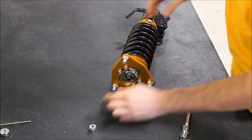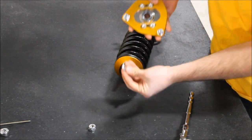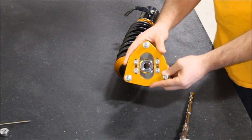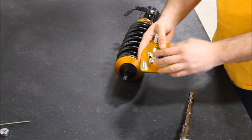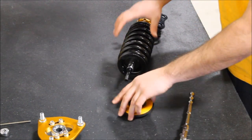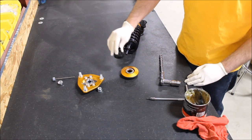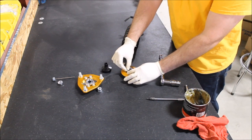Now that our 19 millimeter nut is off, we will find a small washer right here. Put that aside — don't lose that. Here's your whole camber plate assembly. They will look different from model to model, whether it is a pillow ball upper mount without the adjustable camber or just a plain top plate — either way it's going to look the same. Now your thrust bearing will simply slide out. Then simply lift the top black cup off of the spring perch with the insert in it, and the bearings are free floating in there.